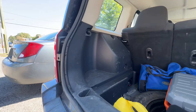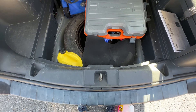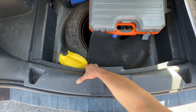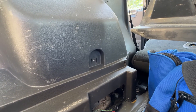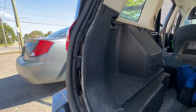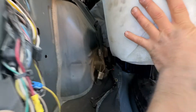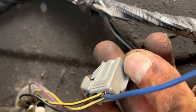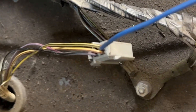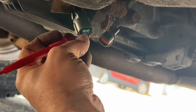The resistance on the yellow and black wire tells us there's an open circuit somewhere. There's another connector inside the car we can back-probe to determine whether the open is inside or outside the vehicle. After removing some plastic panels in the rear and pulling back the interior panel, we back-probe the yellow and black wire and check continuity to the ECC connector — no continuity confirmed. The open is in the ECC wire harness outside the car.